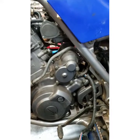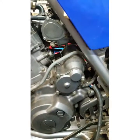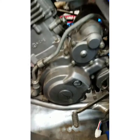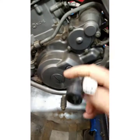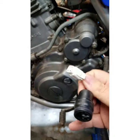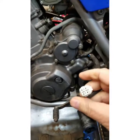This one is starting good, idling good, running good, everything's fine. But on top end it bangs out — just cuts out. I was jetting the carbs for the big bore kit, but I got to checking this and the pickup coil is very bad.